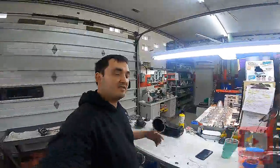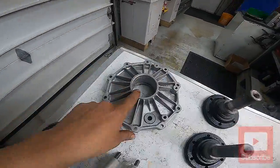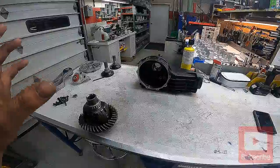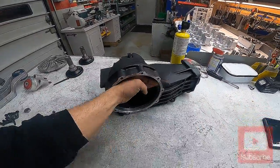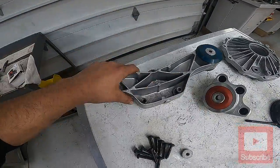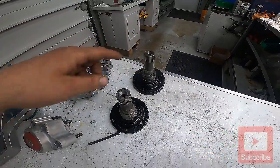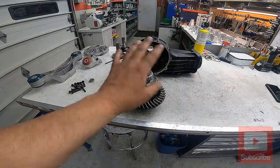Day three, March 13th — so that means I've been doing this for three days, not that it actually took me three days. You can realistically get this done in about an hour and a half if you have everything you need ahead of time. For this build I would highly recommend getting two seals on order ahead of time. I did paint my case today, aqua blasted the rear diff, the carrier mount, and the cover, and repainted the axle cups — so it's all nice and pretty and ready to go back together.